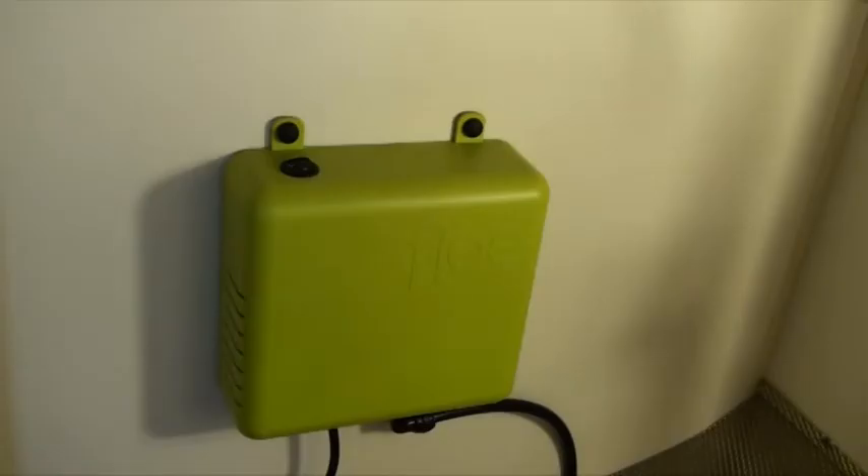Now while you remember, there are vents on the side of Flow here as you can see. These vents allow air to be drawn in, where it is then compressed. It's that compressed air that is pushed into the water system. So it's very important not to cover these vents with any coats etc., because you'll just starve it of air and make it overheat.